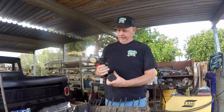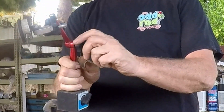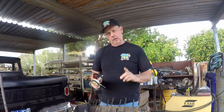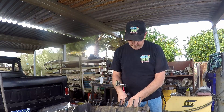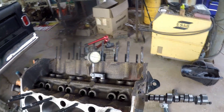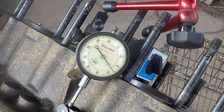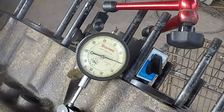So this is what we're going to be using - this funky weird little tool to get our lift. This is a dial indicator. So I have to do this - it's a magnetic base. I'm going to position it on here; with one knob here we're going to control it and put it down so that as I move that we'll be able to get our reading. Come along for the ride. All right, you can see the dial there. I'm going to reposition so you guys can see that better. Starting out at zero - let's see what we got.